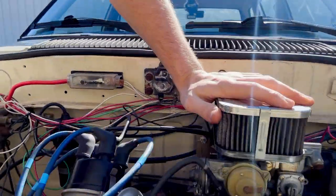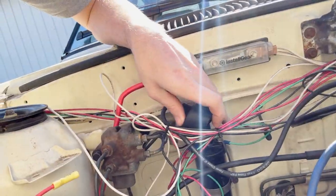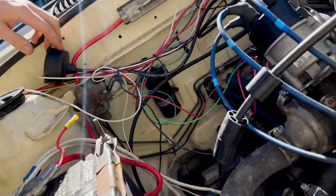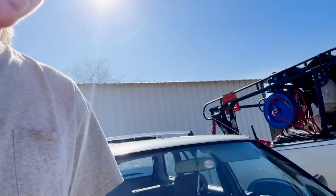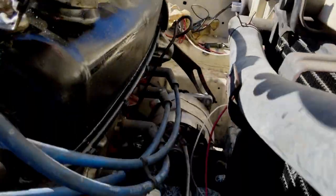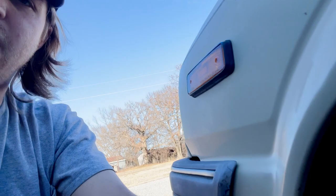There's also a 12-volt going to the ignition coil and a ground I'll be able to use whenever the J-series is in there. Just making note of stuff so I know what I have to work with when I go back together. I just took this wire off while making this video so I can remember it — that was the coolant temp sensor wire. I'm setting it over here since it's the same color as the oil pressure switch wire.